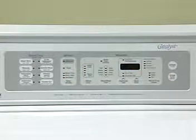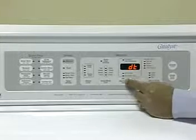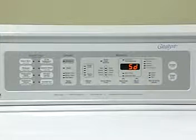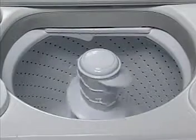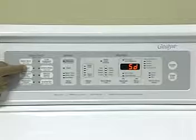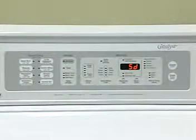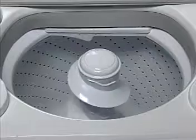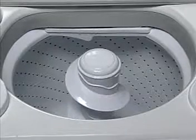The sales demonstration mode can be initiated by pressing the following keypads in sequence within five seconds: agitation time, delay time, agitation time, delay time, agitation time. The LED will display SD, indicating the control board is in the sales demonstration mode. This mode bypasses the lid switch, so the agitation function can be seen with the lid open. By pressing the heavy duty keypad, the washer will agitate in high speed. By pressing either the regular or permanent press keypads, the washer will agitate in slow speed. By pressing the hand wash keypad, the washer will agitate in extra slow speed. By pressing the ultra hand wash keypad, the washer will agitate in extra slow speed and then pause in an intermittent sequence.